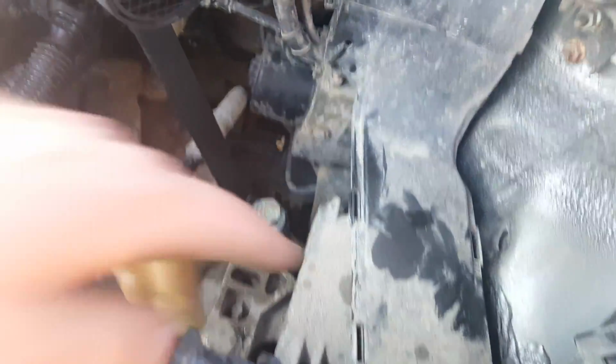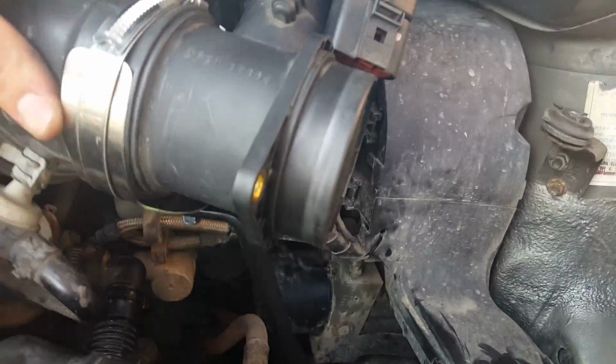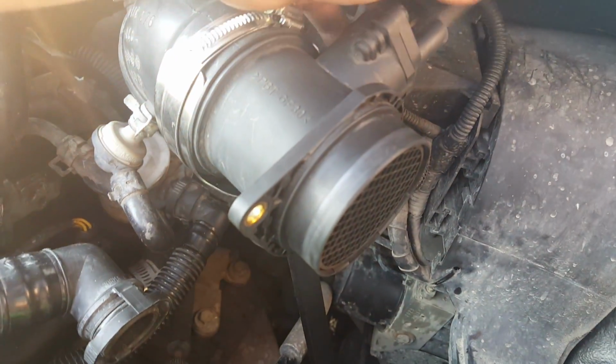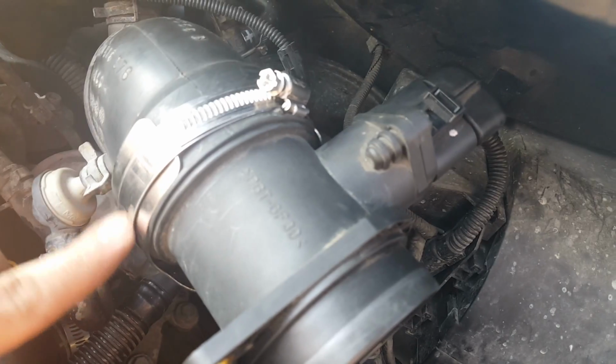So now, okay, after you've bolted this on, you're gonna put your bracket like here. And what I did to keep this a tight, firm, secure lock, so this hose isn't moving anymore, I put the mass airflow piece back in, and now I'm just gonna connect the sensor. So the sensor's connected up. Now what I did is I ran this in here, and I took the hose clamp that was supported with it, and I just literally tightened the whole piece.